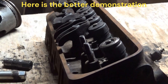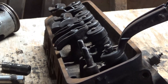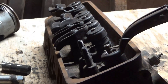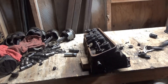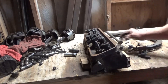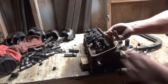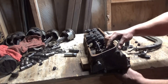Alright, to take it out: you put this on the top, center it on the valve at the bottom, squish it, and then get the keepers out of there — that's these two little things that go in that groove. To release it, just take it off of there. Now that you have that off, this comes out, this little thing comes out, the spring comes out, the seal comes out. Don't let your valve fall — I almost did that. And now the valve just pulls out.